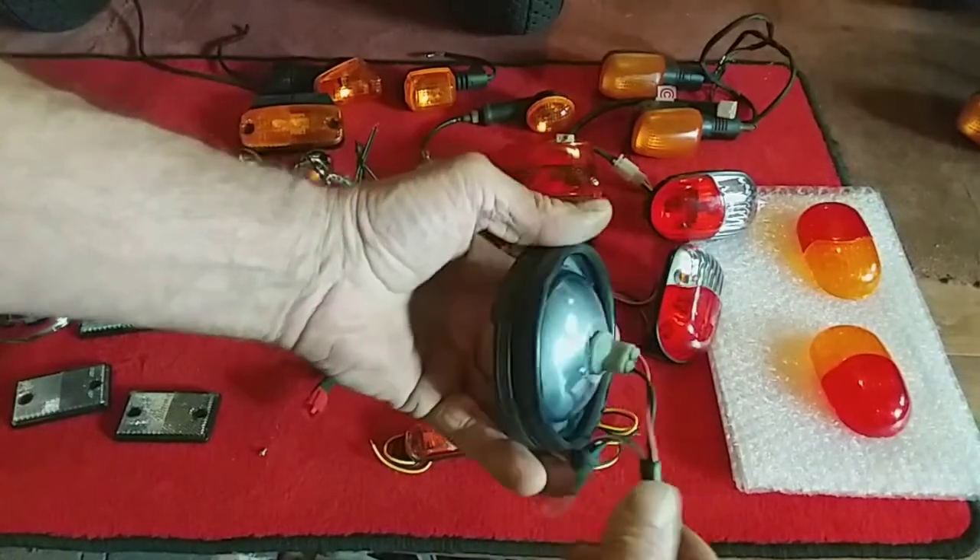I've took that fitting out now. There are several different ways to extend your wires if your indicators and lights are further apart because you've put a bonnet on. You can remember that in the old days red was positive and black was negative, but now it's brown positive and blue negative - so red and brown together, blue and black together. You can put a bit of sleeving on there and solder it using a small soldering iron. After you've soldered to get the wire longer, push the sleeving over the solder, tape it round, then do the same on the other side - solder it, slide the sleeving over, tape it up and you've got a join. That's a good permanent way.